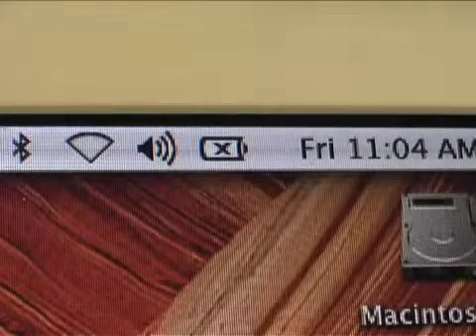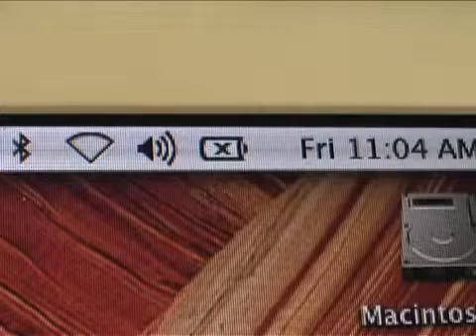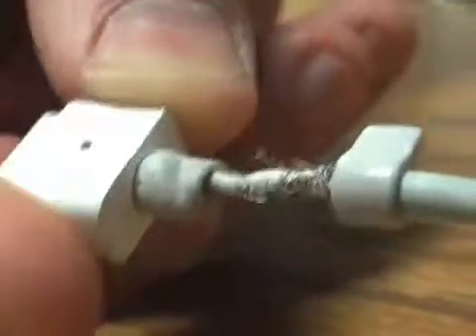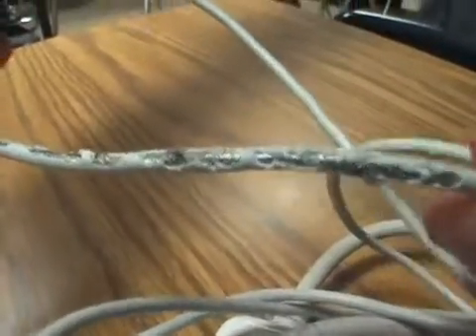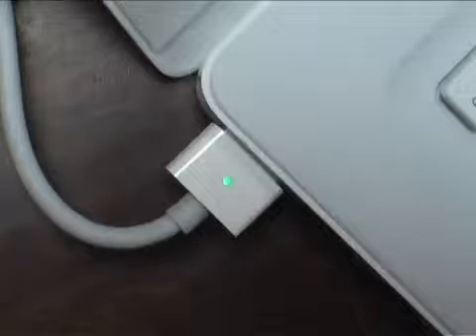You need power to run these things, so let's check the adapter. Check the battery icon on the MacBook and make sure it does not have an X through it. Check for a missing adapter — yes or no. The power adapter should be intact with cable ends not frayed, cut, or stripped. Check right at the power brick to make sure the cable is not pulling away from the adapter. Verify the adapter light is on — a green or amber light should be showing when plugged into the MacBook.